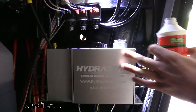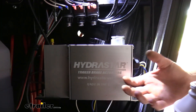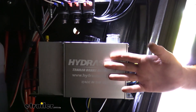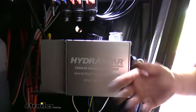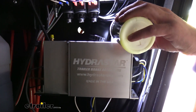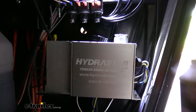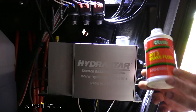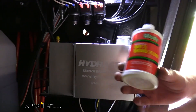When bleeding your brakes, make sure your cap is off and do it in short bursts just like we did back there. We only bled out a little bit and then closed it right back off because the reservoir only holds so much fluid and we don't want it to be completely drained out or else we have to start all over again. Just do it in short bursts, and your assistant can be up here to make sure the fluid level remains topped up. You want to make sure that you're using DOT 3 or DOT 4 brake fluid with your actuator — we're going to be using DOT 3 today.